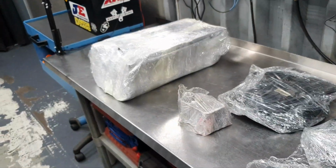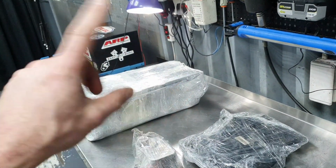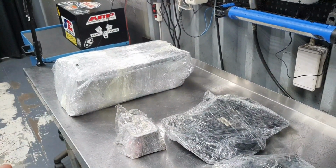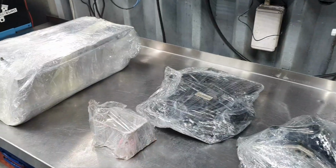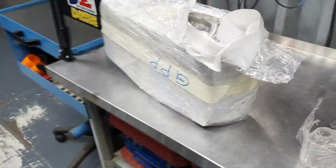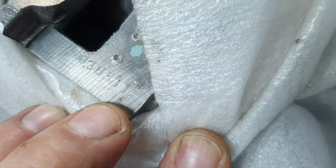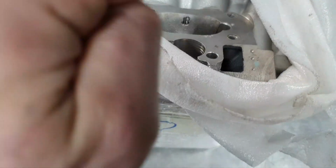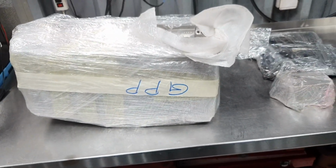So, give me a second to also open the cylinder head to see the number, to see if what I received is for the CJX or the DJH. Plus, as far as I know, the owner will bring me upgrade valves, springs, retainers for the DJH I'm talking about. I haven't received anything yet, or maybe they put it in the office and hid it again. Let's open to see the number. Nope, this cylinder head is for the CJX. This is 112. Okay, so this is for the CJX, the engine that I have outside. Yeah, lovely. Okay, all right.